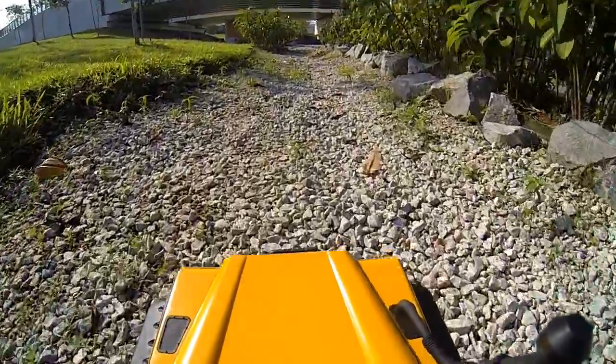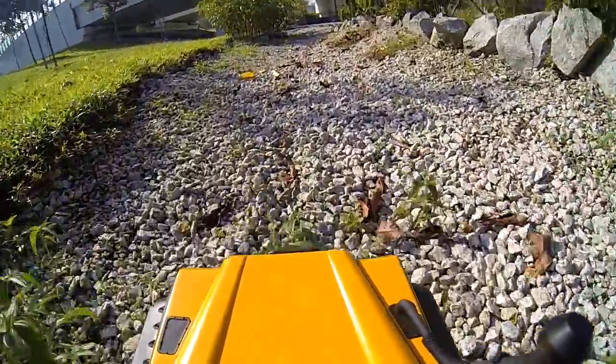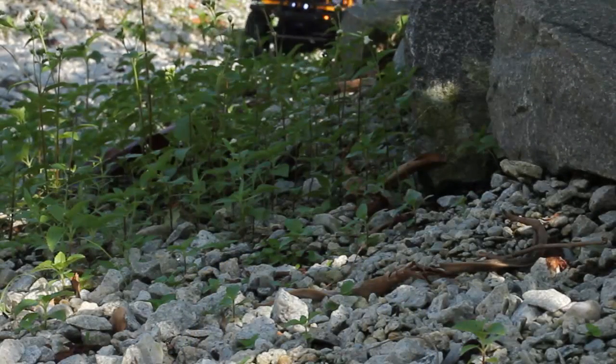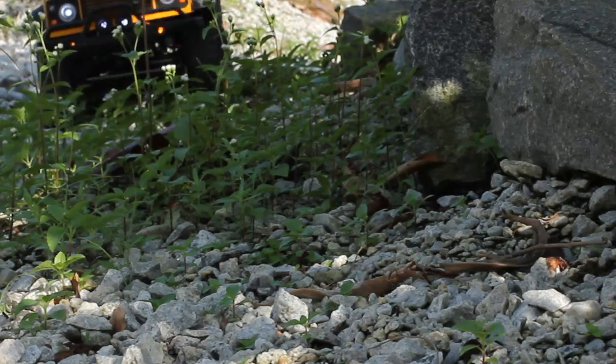Try to be aware of the position of your wheels and ground clearance as you approach each obstacle. It's a good idea for someone to check your progress from outside the vehicle, acting as a marshal to guide you on the best course. It's wise to keep your thumbs on the outer rim of the steering wheel — this will help prevent any injury should there be any sudden kickback.